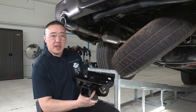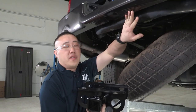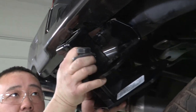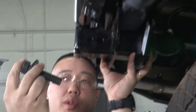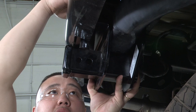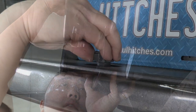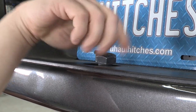When putting this hitch into position, the bumper does sit in the way a little bit of your attachment points, so when you're putting it up you do have to angle it to get it into place. Once you have it into place, you'll take your bolt with the washer and go from the top side to hold it into place so it does not move. Once you have the bolt in, you'll be able to tighten it down to help hold the hitch up into place.